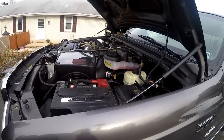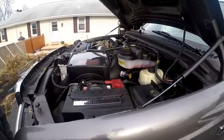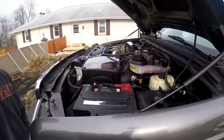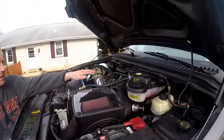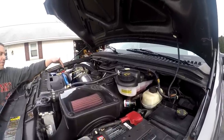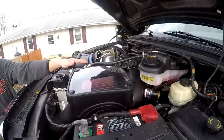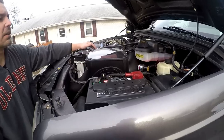So what we're doing is trying to limp it through the winter. It's showing cylinder two and we're assuming it's the injector at this point because of the smoking — we're thinking it's stuck open. Jared does have an injector, so we are putting that injector in cylinder number two. The cylinder order on the driver's side of the 6.0 is 2, 4, 6, 8, and on the passenger side it's 1, 3, 5, 7 — odds on passenger, evens on driver's side.